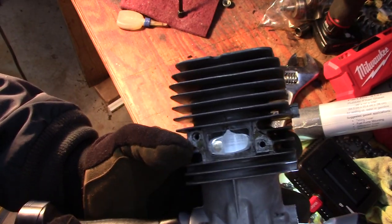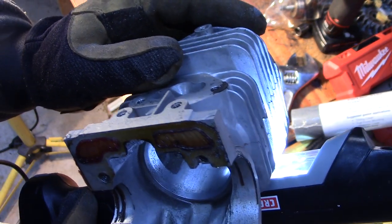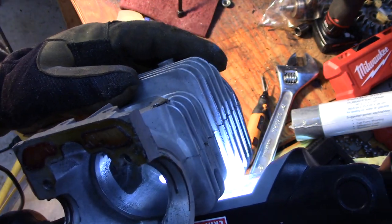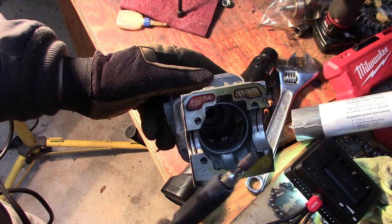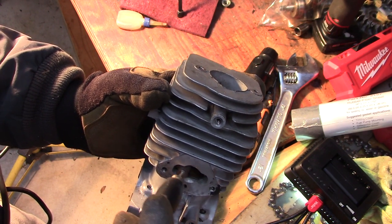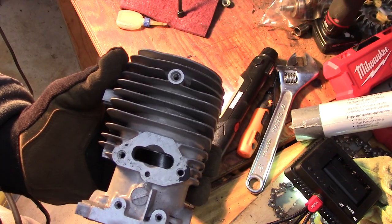Okay guys, I just finished cleaning up that port. For just getting the exhaust out, as you can see on the inside everything looks nice and smooth. I made sure with that sandpaper bit I cleaned up the chrome and gave it a nice chamfer. I'll go in there with a rat tail file too and make sure I knock any edges off. What I ended up using were these little sandpaper bit tips. The next thing I'm going to do is go into the intake and clean up any of that flashing — there's not much here to do because it's all dictated by that plastic piece that goes in here, but there is some flashing and an opportunity to get that off.